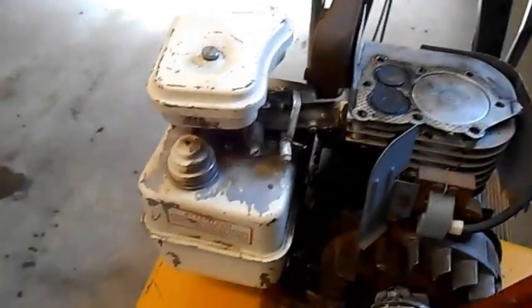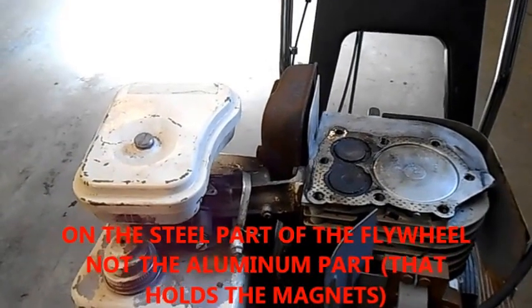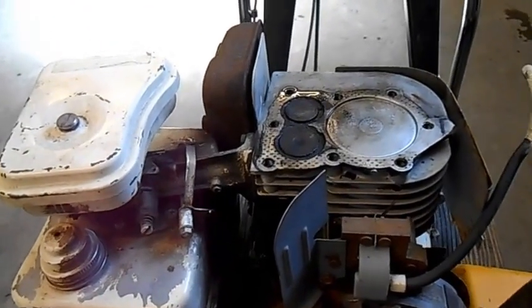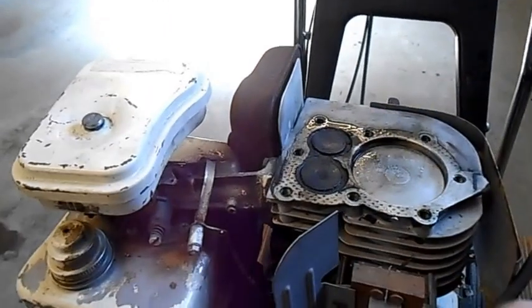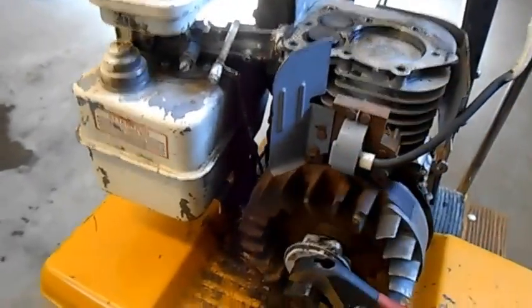So today I took a large drift and I just tapped it on the flywheel, lightly. Although that is a heck of a big drift. And I got the engine to move about a half an inch. So I did it again — lightly, lightly, lightly — and I got the whole thing to rotate completely once. And I put a whole bunch more oil down the cylinder. As you saw in the three horse rebuild, the ratchet lets you go one way. And now it's quite stiff still, but as I use it we are getting more and more movement on the system.